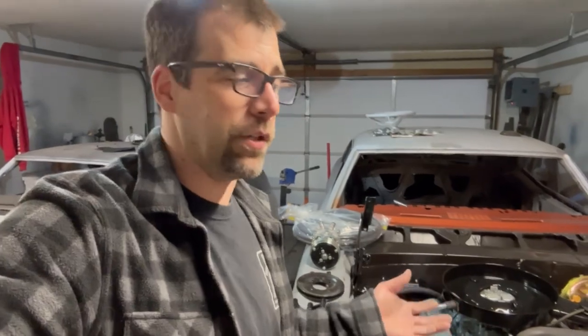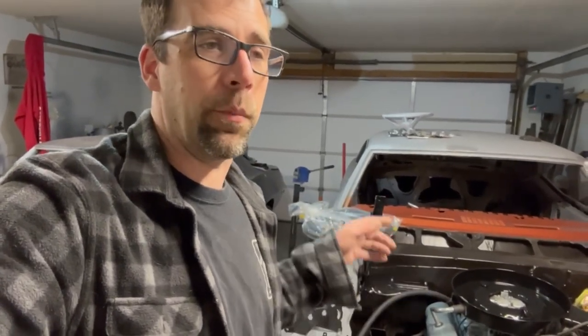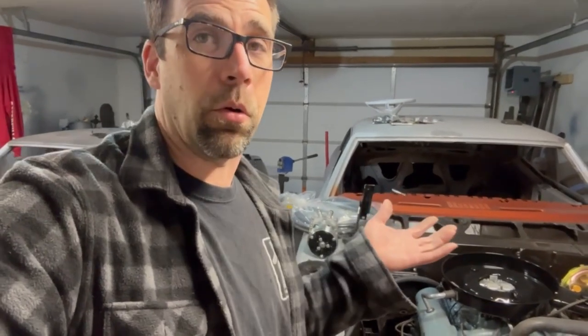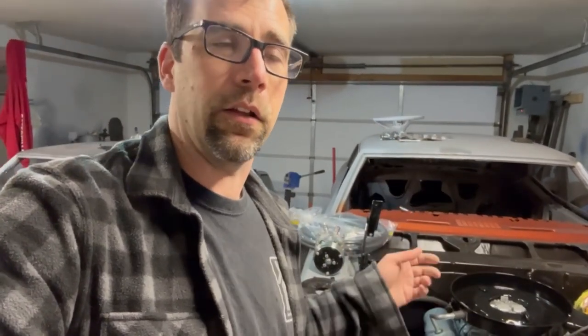Now if it was junk maybe I'd feel differently, but this car's kick panels are in phenomenal shape — I like the functionality and the looks of them. I've already done a few cars without cutting the kick panel, but this is the first one you guys have seen. We're going to retain the factory heater box under the hood to make it look like it has a factory heater core, which takes care of two of my hoses getting hot water inside the dash. I still need to get the two AC lines — high and low side — inside the passenger compartment.